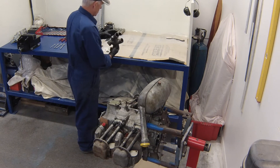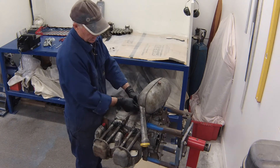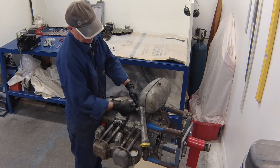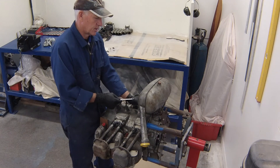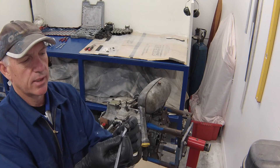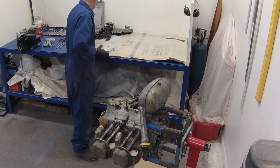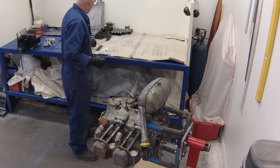Now that we have removed all these items it makes it easier to remove the sump. You'll need a 7/16 ring open ender — there are six nuts located around the circumference of the bowl. Sometimes they are double-nutted, so if they have double nuts you'll need to hold the bottom nut closest to the crankcase halves and undo the top one first. Avoid undoing it with just one ring open ender on the top nut because the stud can wind its way out of the cast aluminum, pulling the thread out of the accessory case or crankcase halves. Undo the top nut first, then the bottom nut, and work your way around all six.